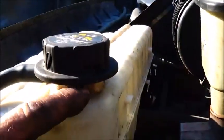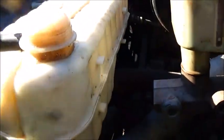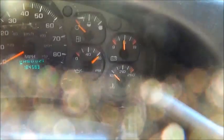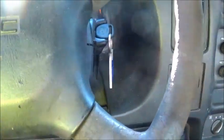It's foaming as you can see — that confirms the blown head gasket. I don't have a problem with that being what's wrong with it, I just don't like not knowing. They may have taken the thermostats out of this thing because the temperature's staying down at 100. So we'll probably pick up a set of thermostats and pull the heads off, see if it's just a gasket situation, and may replace the head bolts with some studs.